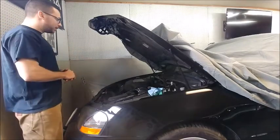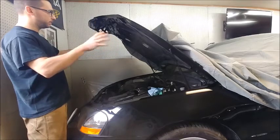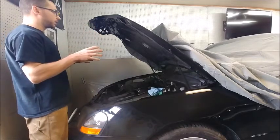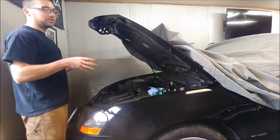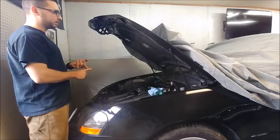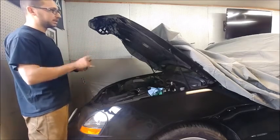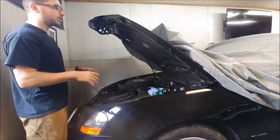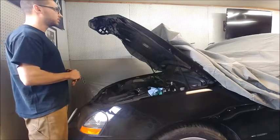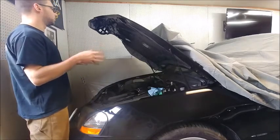Underneath this area is where the actual panel comes under — it's just loose hanging metal, tack-welded on each side. There are actually holes going all the way along from where the rust has eaten away at the paint. I've ground down most of this rust, so it's pretty much ready for paint. I want to do a little more work to tidy up the back and dress that side a bit more. That'll allow us to paint it all at once on the rear end, put the beam back on, and subsequently put the bumper back on. Thankfully the rear structure and sheet metal has not rusted away to the point that it can't be saved.